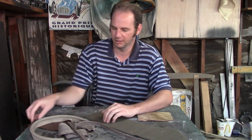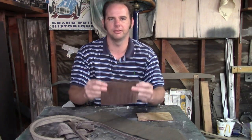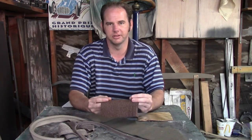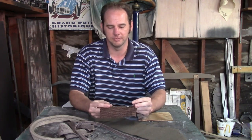The other reason — you probably guessed by now — this is not going to be an all-stock interior. The 1930-31 four-door sedans had a variety of interiors originally, but most commonly there were two, and the same two are most commonly used in restorations today. One of them is this: brown check cloth, commonly used on base models where the seats would be done in this, the panels and headliner in a solid color material that matched, and it would have rubber floor mats.